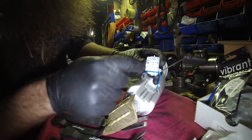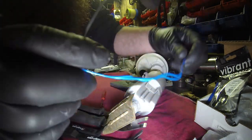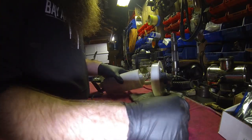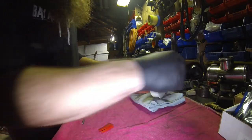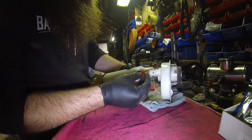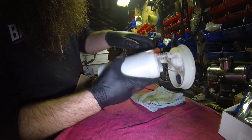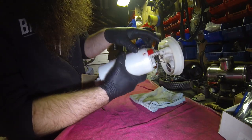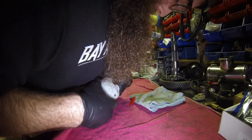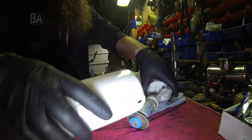Like I said, you can see the channel where it rides. It's got the lock on the bottom, and then it's got these guides here that keep it through. So you pull that off and set it to the side. Now that we got the connector out of it, put this over here with the connector itself so they're together. You take the tool that they give you in the kit and you worm it in through the canister. There's a skinny one, and then you got these two fatter ones that are together. You worm this tool into the skinny one, pry it, it'll pop open, and then you just keep prying and it pops through. You'll get that open, and then you pull the pump assembly and everything out.